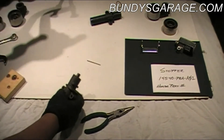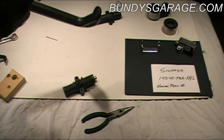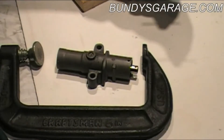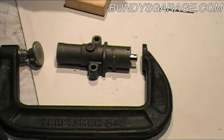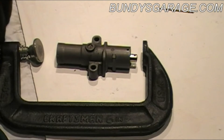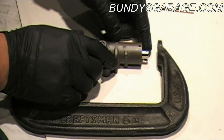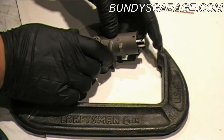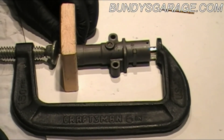So I'm going to show you how to reset this thing. It's basically a tiny little piston inside of here, and there's oil that flows around inside of it. So when you do this, tighten a little bit, give it a rest, tighten it up a little bit more. Make sure you have your drill bit of the appropriate size ready to be dropped in that hole. What I'm going to do is lay it down on the bench, take my C-clamp, and I have a piece of wood. The only reason is that when I do this with a C-clamp, this part here wants to turn. And when it turns, the top of the tensioner is hitting the top of the C-clamp, which tends to turn the whole assembly. So when the holes should be lined up, they're not. So I go ahead and put a piece of wood here as a spacer to stop the tensioner from turning.